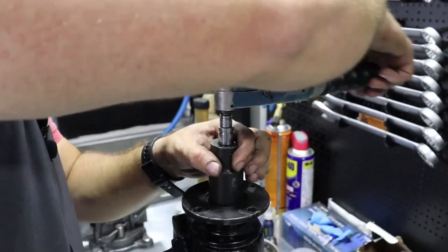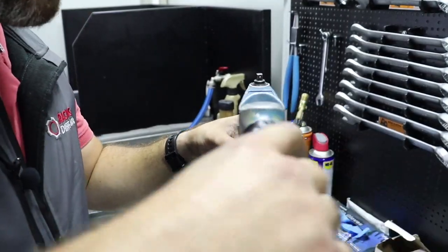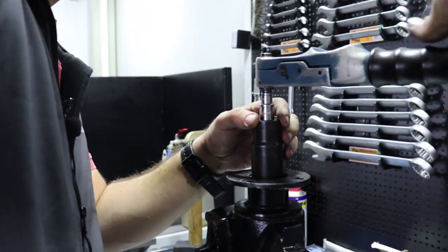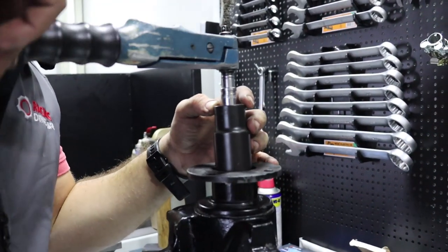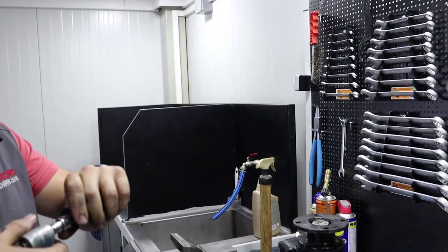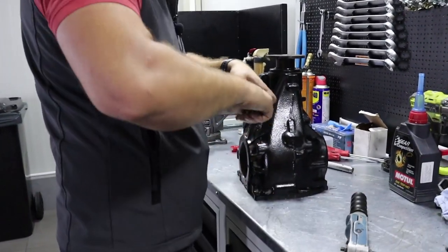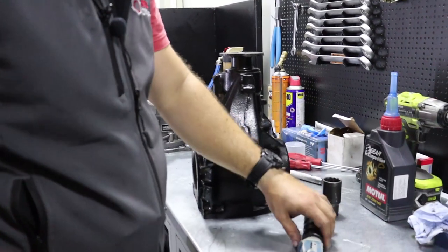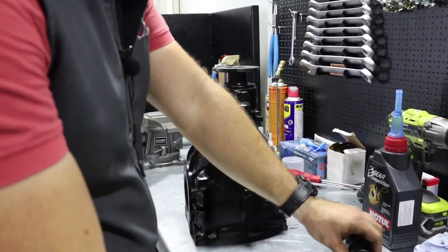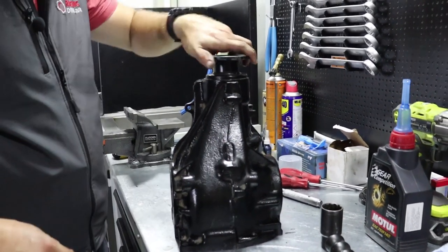And final measuring to confirm you did everything well. Try to keep this as steady as possible so the measuring is relevant. We put it to 1 newton meter, slightly more, but it's better to put it slightly more than slightly less. If you put it below 0.6, then you can expect whining noise. When you release the throttle on the coast, you will have a whining noise.